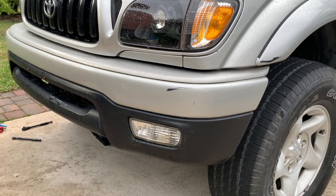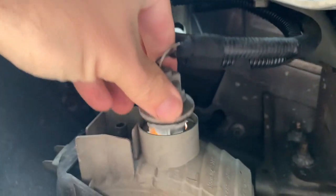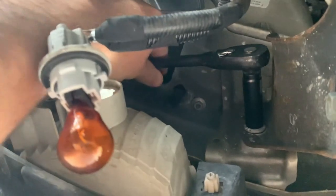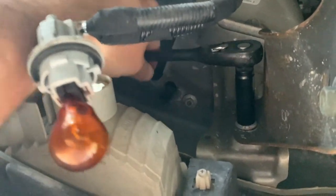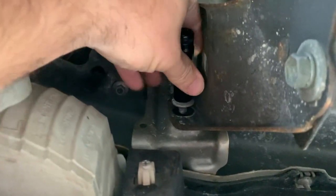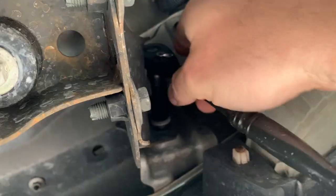The first step to this process is learning how to take your bumper on and off. Twist off the turning signal lights — they just twist and pop right out on both sides, left and right. Then there are two bolts attached to a bracket, I think they're 10mm. A little hard to get in there but with patience you'll get those out. Now behind the plastic cowling in the wheel well is another bolt; there's a hole right there to get to it.